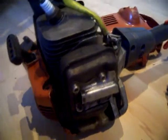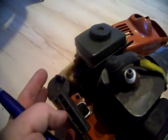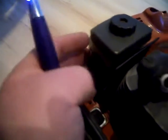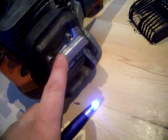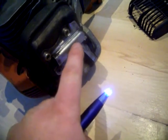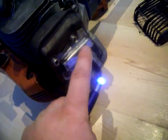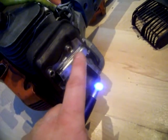So that's something worth considering. If you've tried everything else — like normally if there's a blockage it's the air filter, or it could be old petrol in there, you want to drain all the fuel system out. If you've never taken this off and you've got a really old strimmer, it's worth checking it. See if there's a buildup of soot or crap.